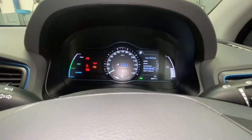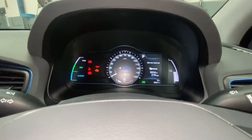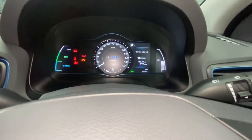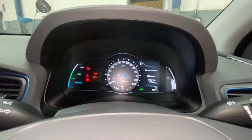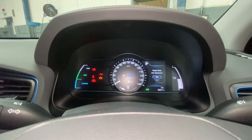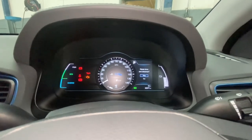When you've found service interval, press the button in — there's an OK button on it as well, so push it in to enter. As you can see, it shows nine thousand nine hundred and thirty-two miles and two hundred and seventy-six days. Press and hold the button until it resets — you'll see it says 'reset time and distance' and then 'yes'.